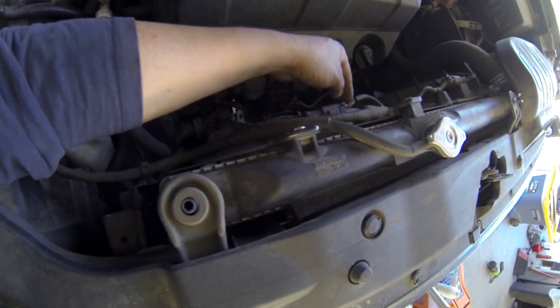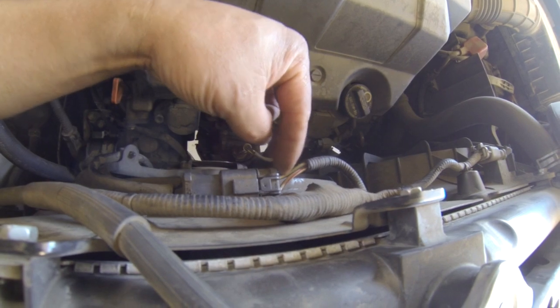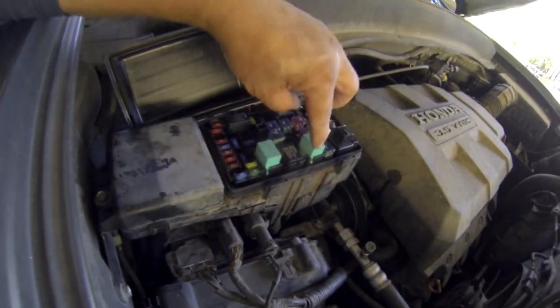But in this case, both the radiator fan and the cooling condenser fan work. So I put a ground wire right here — the green, the blue and yellow here is the ground side, and the red and white is the positive side. I connected it straight to those two wires, and when I put ground on it, anytime the AC shuts off the fan kicks. The fan is kicking right there, but it doesn't work when the AC is actually running.